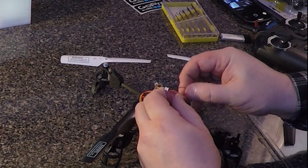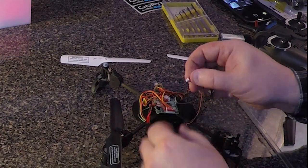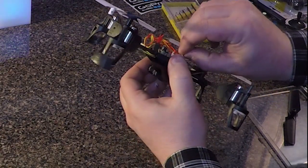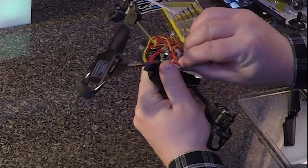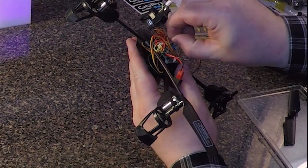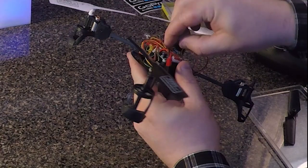Next, take a look at your wiring. Depending on the replacement arm you purchased, different manufacturers use different color wiring. Be sure to plug the connector for the motor into the bank of wires that are yellow and red. The other connector is for the LED — it gets plugged into the bank that are red and black.